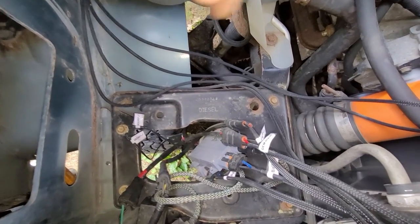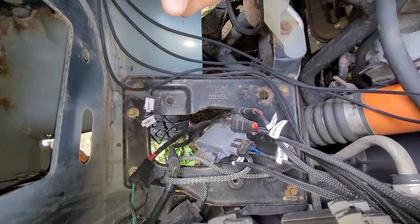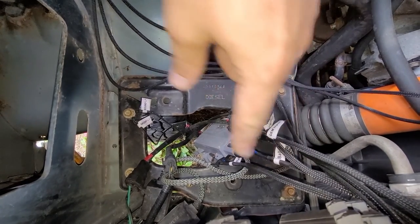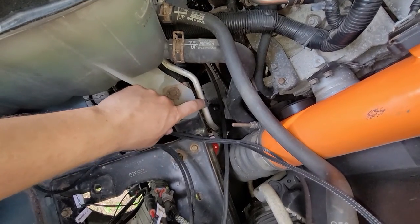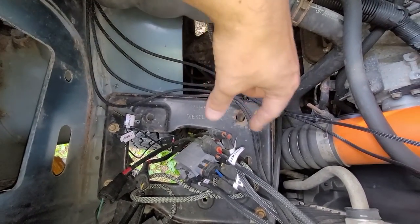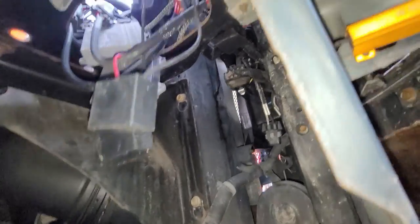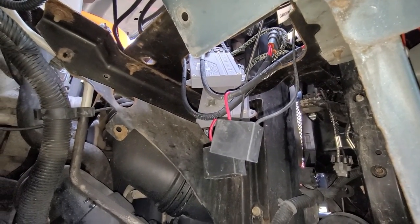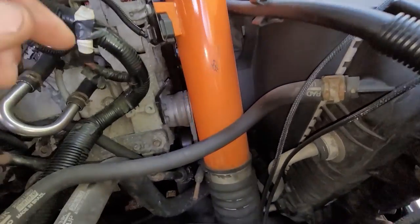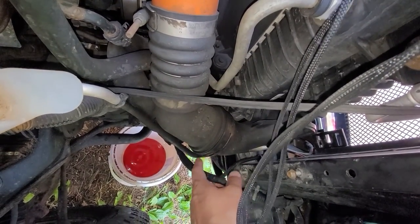I can't believe it's still draining — I had to switch out the pails. Next, we're going to take out the factory air box. There are four 10mm bolts there, one 10mm bolt right there, and this black clip we've got to pull out. It comes out in two sections, but I'll take both out for ease. Then down here we've got one bolt there, another up there, and the whole thing should pop right out. On the intercooler, there's a clip here — use a flat head or pick to clip it out.